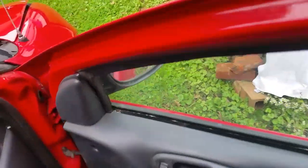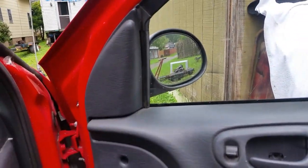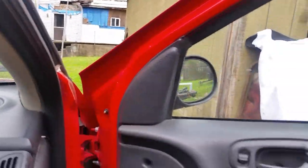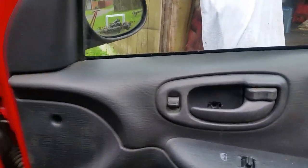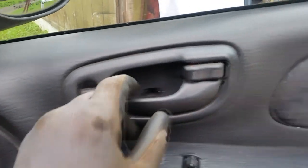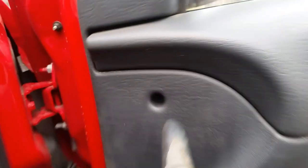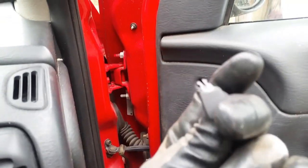What we're doing now is taking off the door panel. I'm going to go ahead and keep this power mirror. This model has power mirrors, which is operated over there on the driver's side door. To get this power mirror off, you have to take this panel off. The panel is pretty easy — you've got a screw here behind this handle, one down there, and one right there. These are Phillips screws, and you'll have to pop these little covers off.